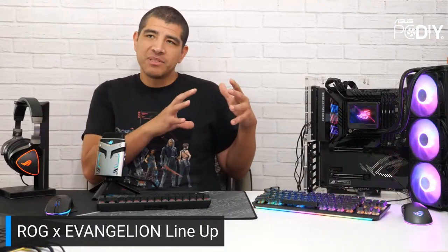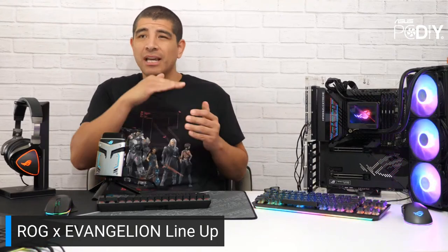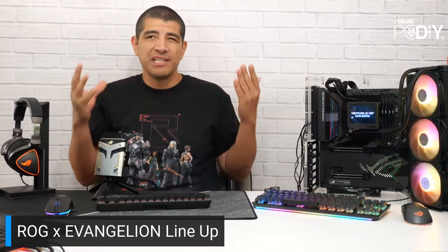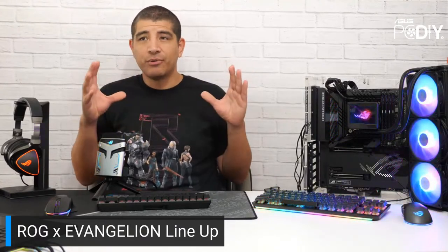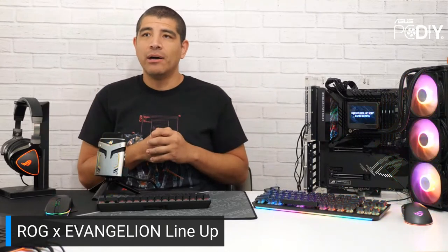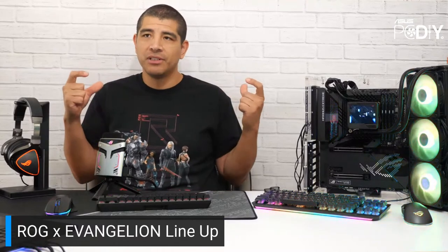But sometimes, depending on the metal within your chassis, some metals are softer, some are a little bit harder. It depends on the mix that the chassis vendor is using. You will sometimes notice maybe a little bit more sag. I'd say overall, in most situations, it's not a lot. It's going to look pretty clean, but some users may still prefer to have some form of bracket or brace to make sure the card is fully streamlined, right?